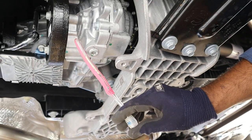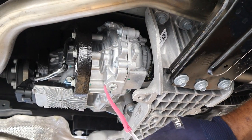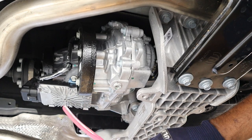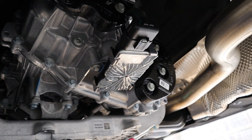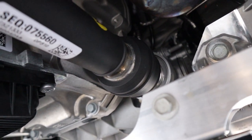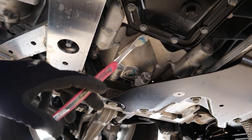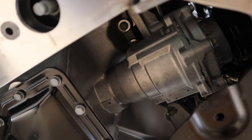What really makes this vehicle a Jeep and very capable off-road — unlike your uncle's Hyundai Santa Fe — is the transfer case. On the higher-end models the transfer case has a low gear range, allowing you to crawl over really steep obstacles at very slow speeds. Any four-wheel drive system is going to have extra fluid to service — there's the transfer case fluid drain and fill port. The transfer case sends power out through a shaft to the front differential unit. The front differential has its own fluid with a drain port and fill port, sending power out to the axle on the passenger side and, on the driver's side, out through the oil pan connection to that wheel.